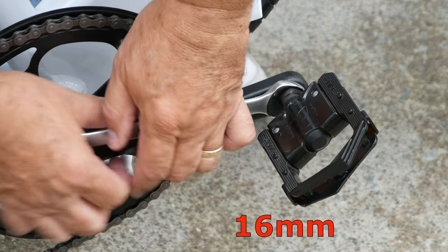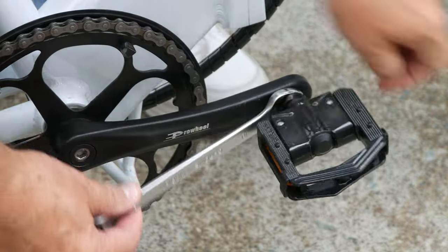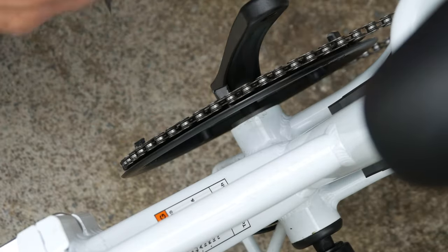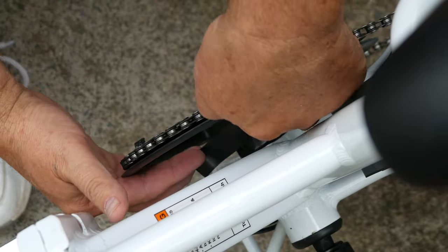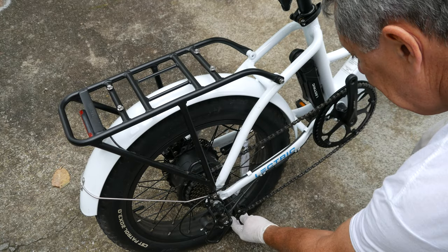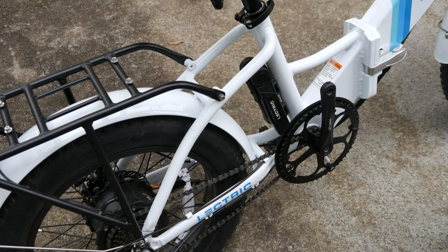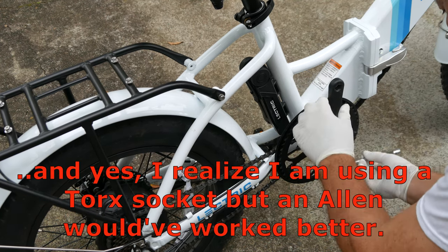We begin the operation by removing the right-side pedal. Technically you could leave this on for additional leverage, but I find it easier to remove the pedal now. Removal of the chain is also optional, but if you are going to remove it as I am, consider protecting the bike frame from grease and scratches from the chain. I grabbed the derailleur with my gloved hand and, while taking the pressure off the chain, remove the chain from the crank assembly and gently lay it over the protected frame area. Next, remove the crank bolt slash dust cover by turning it counterclockwise.